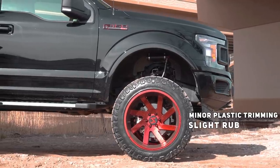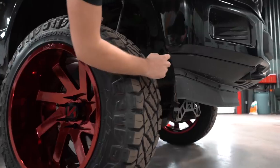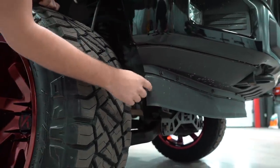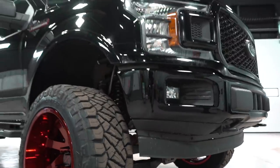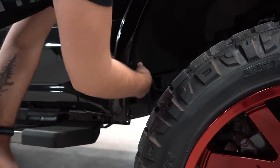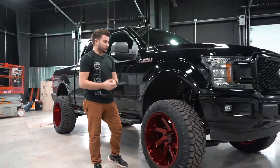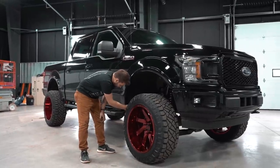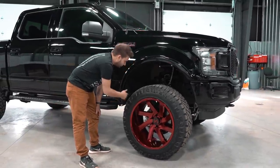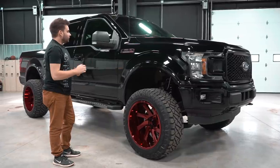As far as rubbing and trimming goes, he just finished this thing so he hasn't quite trimmed it up how he wanted to yet. We took off the bottom part of the valence here to clear the front — you could just remove the whole plastic valence if you wanted to, then trim up the top piece. Out back, nothing done yet other than cutting off some of the plastic. The fender liner has been removed as well as the crash bars — he took them out in the back and up front too since he had the thing completely torn apart. We'll come in here, smash this back with a hammer, give you the NorCal mod on an F-150, then heat up this plastic trim so you can clear it with no rubbing. Otherwise as it sits, with some plastic trimming, you do get rubbing at full lock coming in and out of driveways.